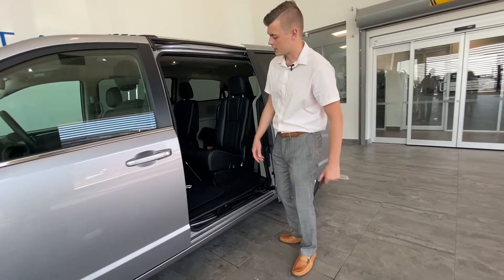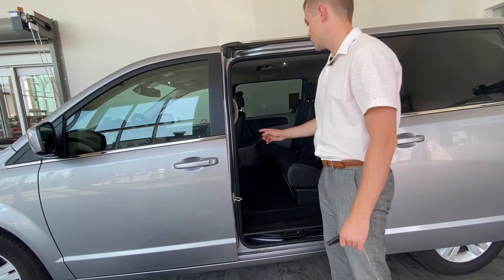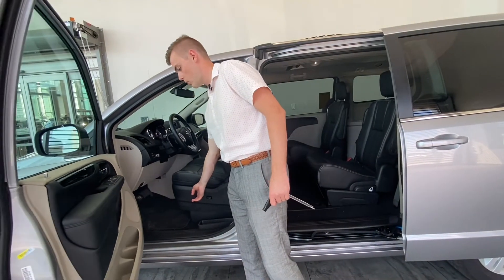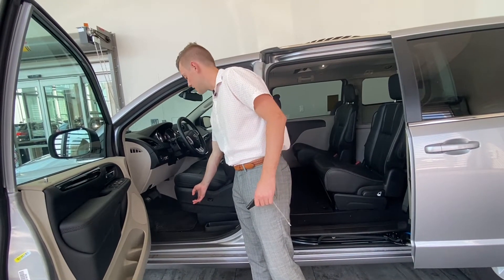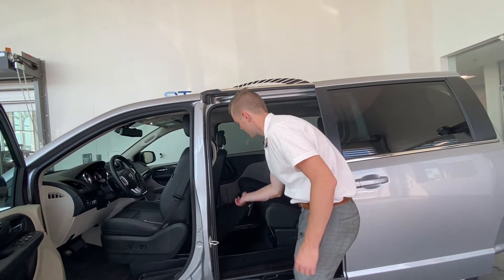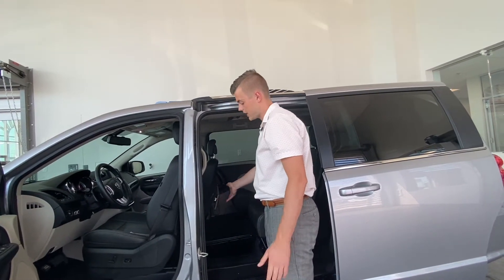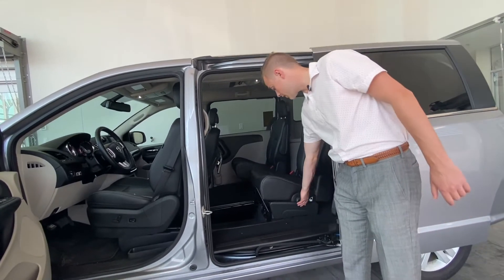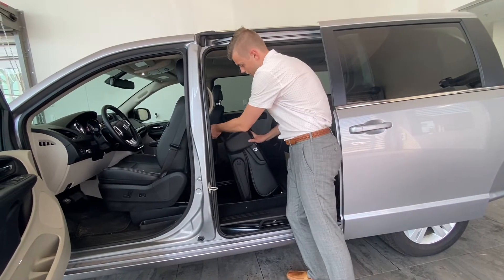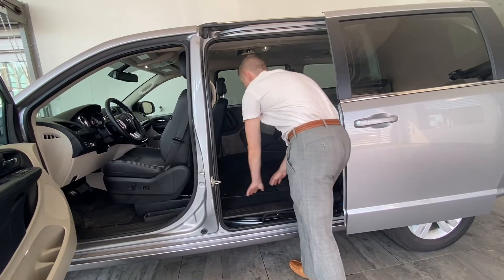We have what's called the stow and go, which I'm going to demonstrate for you right now. You just got to pull the mat right out, put it on the floor for now. Make sure your driver's seat or passenger's seat on the other side — because this vehicle does have it on either side — is all the way forward, it just makes it the easiest getting it in there. So now you're just going to go ahead and pull this floor up. It has a frame to it that will actually have it stay up, just like that. And then it's just as easy as going in and pulling on this handle here — the whole thing will tumble, rotate right in there just about by itself — and then you just push this down in, lay the floor down, and there you have it.